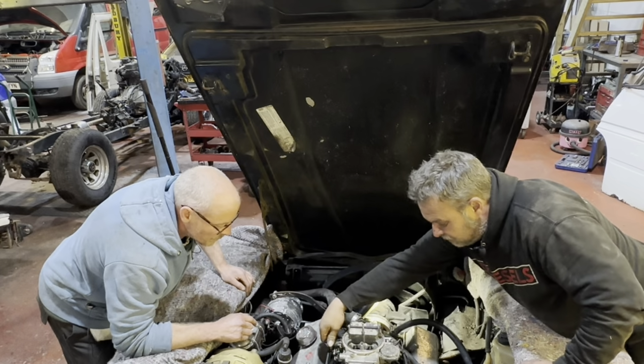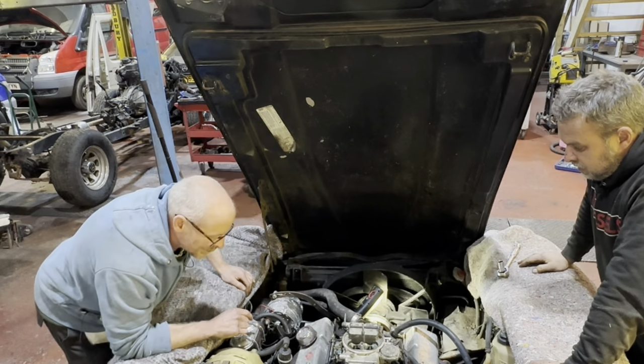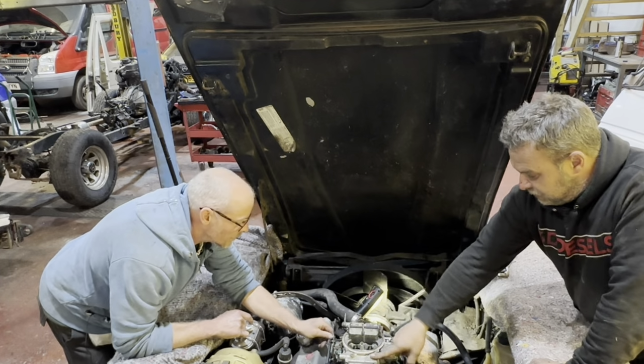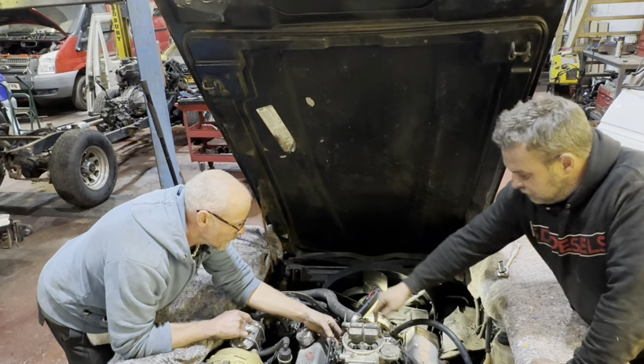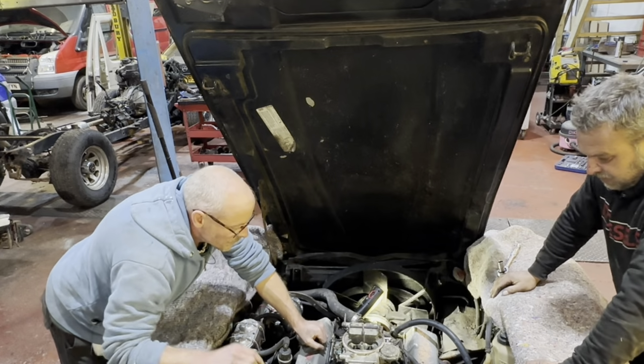And obviously your secondaries, I'm assuming, are vacuum operated on this, aren't they? Yeah, because you've got two, basically. Those are your float chambers either side, aren't they? Yeah. So we must have a link pipe going through. Yes, we do. So that's main fuel in.